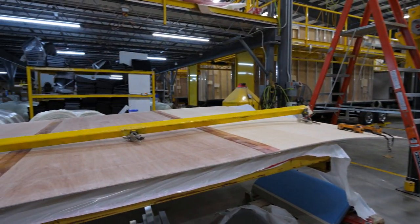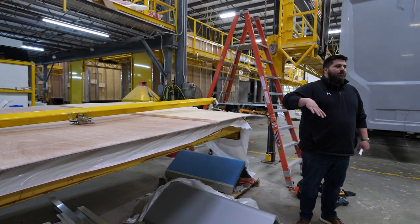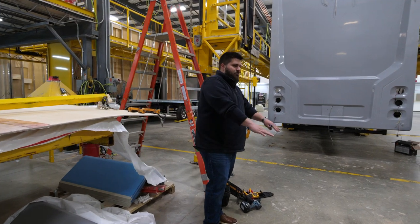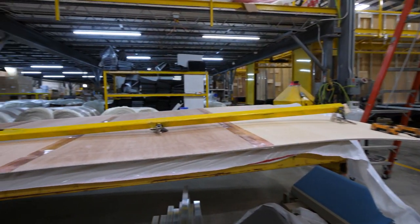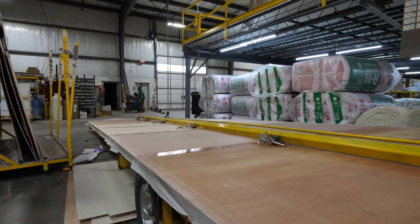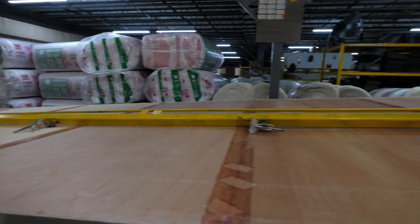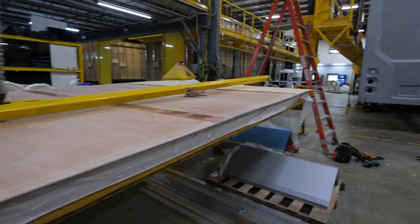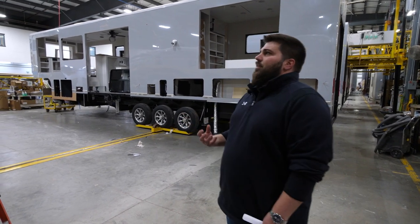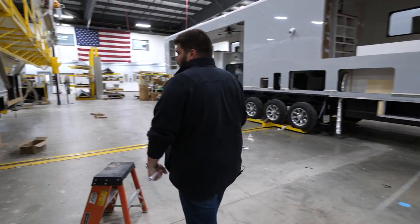One thing people talk about is your exterior wall — whether it's Luan or a laminated wall. Here's our true gel coat wall. There's actually a 45-foot mold; they spray that gel coat material on — it's not a rolled piece of fiberglass glued and laminated to Luan. That gel coat is wet and then the Luan is put right on there. It's one of the only truly automated processes I've seen in the RV industry. They can scan a barcode on this wall and tell you exactly how much material was used on that mold, so they can check after every run. Doing it with wet gel coat actually allows it to get into the Luan instead of just gluing it on, getting rid of almost all of the delamination you would see.